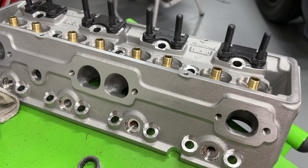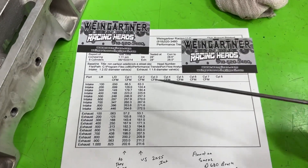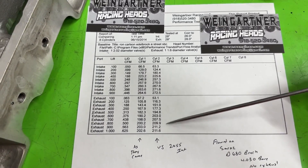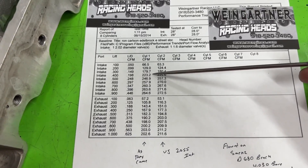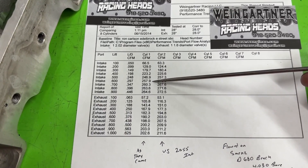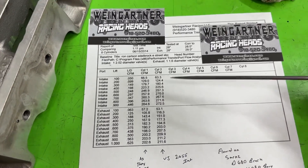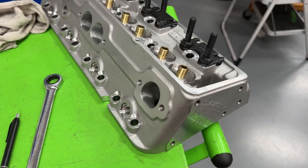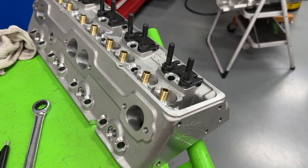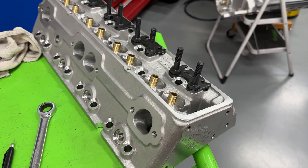Someone had ported these with a very mild job. This is the flow bench — a 4030 Superflow bench. Here are the stock numbers versus putting in the bigger valve and redoing the valve job. At 400 lift it's 223 CFM stock, then 257 at 600 lift, which is really good, and it peaks around 265-266. That's really not bad flow for this head. If you get these from the scrapyard or wherever, they're not bad — they're better than any Vortec head, and it's not even close.